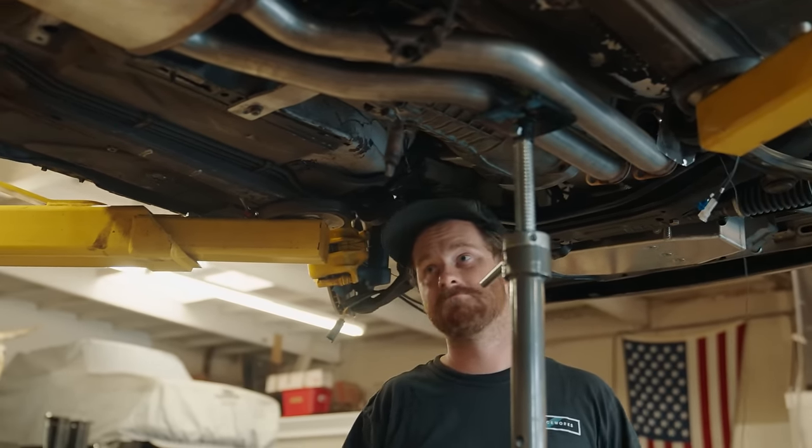I'm making multiple pieces and parts work here — the back half is an E46 system, and we just have to bridge the front to the E36 headers that don't really clear the floor. I bought some U-bends down the street because I'm in a rush. They're not exactly the same size — off by about a millimeter, not even the thickness of our welding rod — so I'm not worried about impeding flow or having any negative effects. Once welded up it's completely impossible to tell, so I'd call that a success.